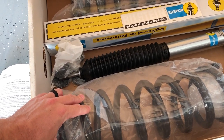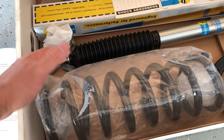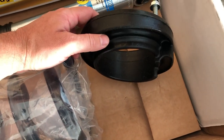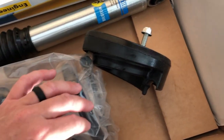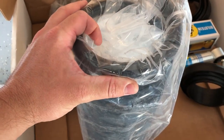We're going to leave the 4600s on the back and put the 5100s on the front. Then we install the new springs — they're probably not progressive, so they should yield a very similar ride, but they'll raise it 2 to 2.3 inches. We also change out the isolators. This is essentially what the coil spacer was — it just had an alignment stud — but these isolators are different sizes, so we'll take a measurement to show you.